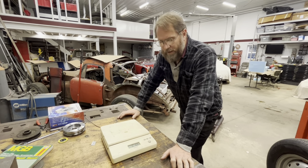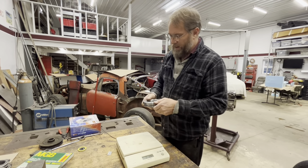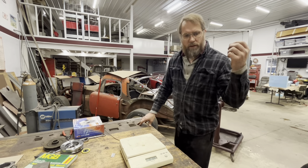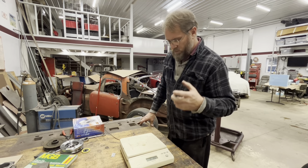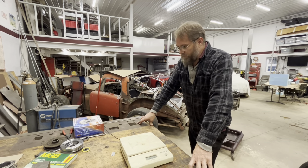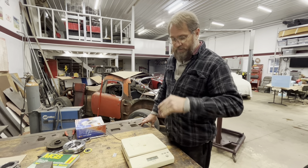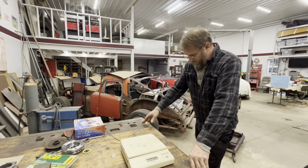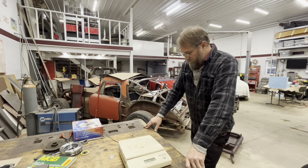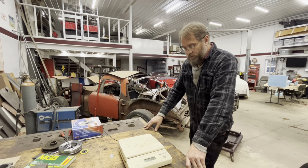I think maybe I went too far last time. Doing stuff like this - the damper and what I did with the oil pan to control oil foaming and oil surge - will hopefully help control harmonics and make an engine that'll actually last this time. Fortunately, my engines are the only engines I've ever built that didn't last; every one of my customers' engines has always done just fine. But this engine involved a lot of stuff I've never done before, so with new territory comes problems.